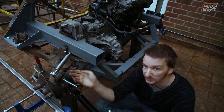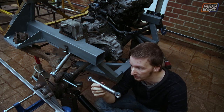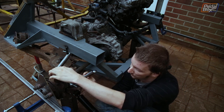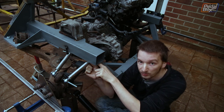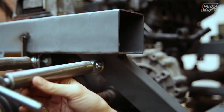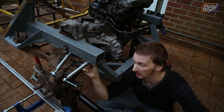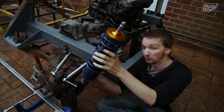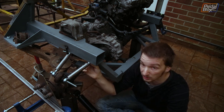With the forward upper control arm in, we've actually been able to set our camber vertically upright, which saves some work on the jig. Mocking up with the other front control arm on the right-hand side compressed all the way in, we find the end of the link comes in perfectly underneath the bottom of the chassis leg and right up against the side of the drop-down for the rear end — giving a really strong attachment point. With this positioning we can also still fit the coilover without it getting majorly in the way, reaching a good angle without needing a bent arm or anything.